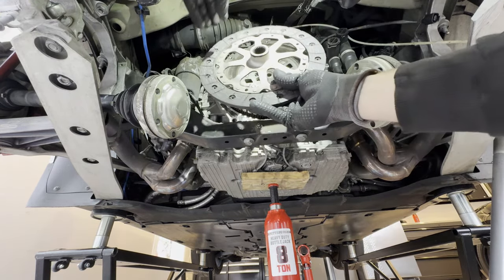There's also a vacuum hose to attach out there — make sure you route that. Next, take the bottom panel, slide it back into place, and fasten it down. Once you slide it in, torque all the nuts to 48 foot-pounds. Then take the sway bar and slide it over the panel, loosely hook it up at the toe link and at the bushing mount, finger tight. Tighten the two bolts holding the rubber bushing to the subframe to 17 foot-pounds, and then this bolt is 48 foot-pounds.